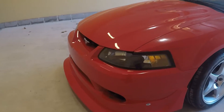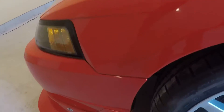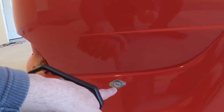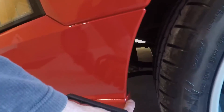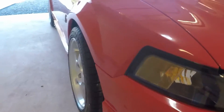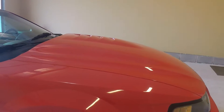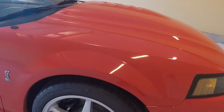So how this works is there is a bracket underneath. The car sits low to the ground. It has these — what they're called — Zeus fasteners on the sides and on the front. It's spelled D-Z-U-S. How they work is you push them in and you turn them a quarter of a turn and they lock in place. There's one on each side, and then they have five on the front. That is really the main thing that holds them locked in place. And there is a metal bracket with two prongs on it — I'll try to show it under the car with it installed, then I'll take this off in a minute.